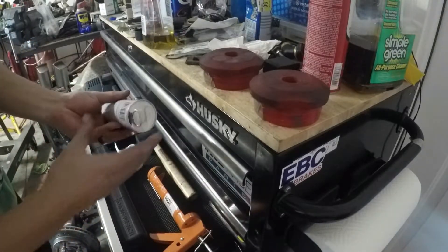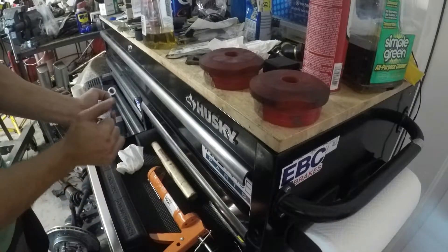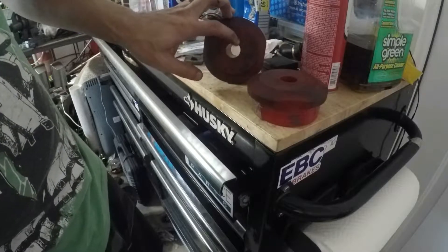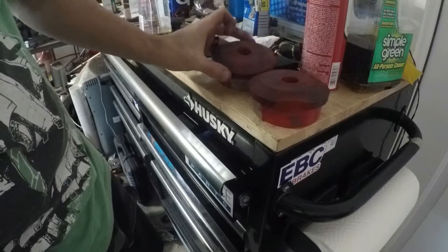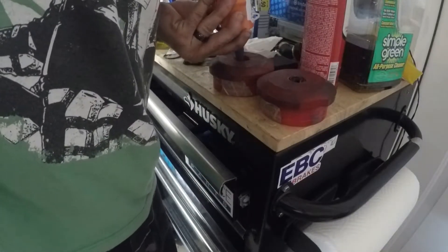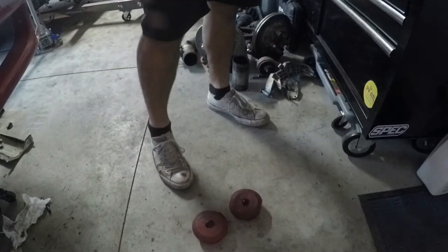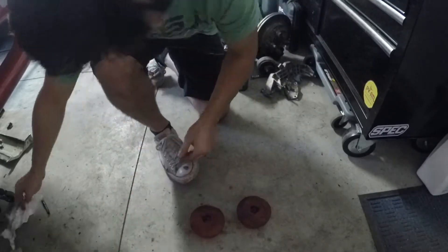We're using 3M window weld, which is between a 55 and a 60 on the durometer scale. We actually have to chop these mounts, which is basically going to decrease the bearing strength in here — it's going to crush — so we have to fill it. I've got some tape on the back side so it won't leak out while it's curing, and then I'll re-drill the hole and put the bushing through. There may be some air pockets because of this, so this is not the best way to do it. Ideally I would have used a more liquid-consistency urethane like I did in the other video. This stuff only has a 15 to 20 minute work time, so if your mounts are bigger plan accordingly.